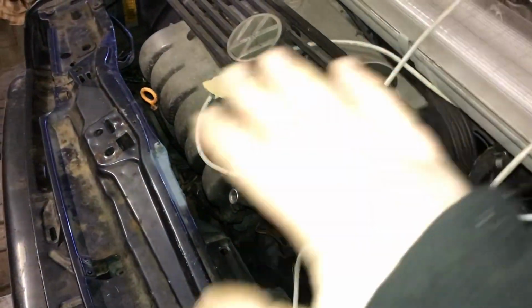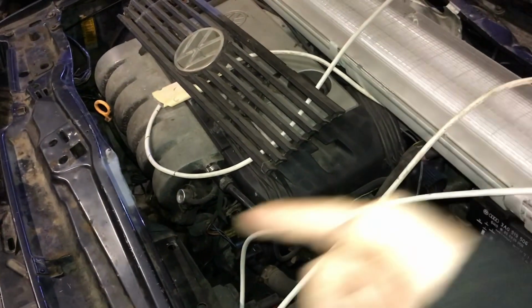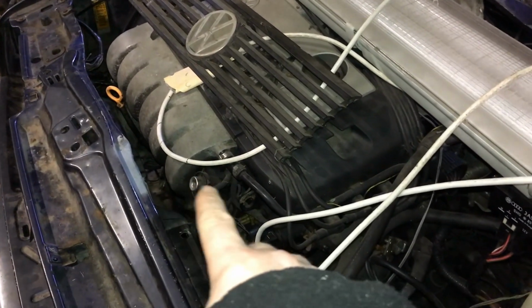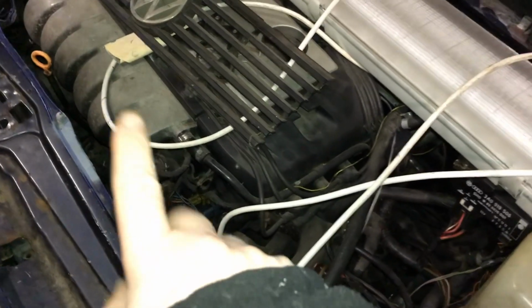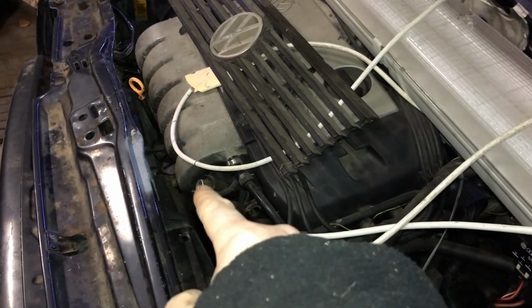I don't know if it sends it back or it just holds it there, but I thought about it, I'm probably sending 6 bar or 9 bar all the way up here for the pressure regulator to just go, what's going on? I'm limiting you to 3 bar and that's all you're getting. And I don't know what to do with the other remaining 6 bar. I thought, better not to overdo that poor little regulator. Maybe better off to just only have 3 bar coming up, and then for spikes or whatever happening, it can regulate it down.